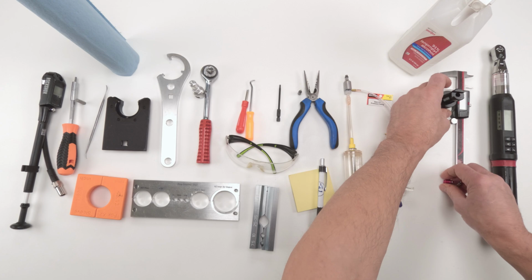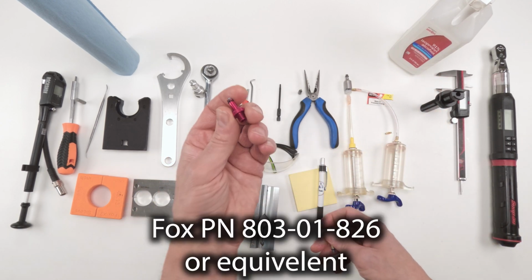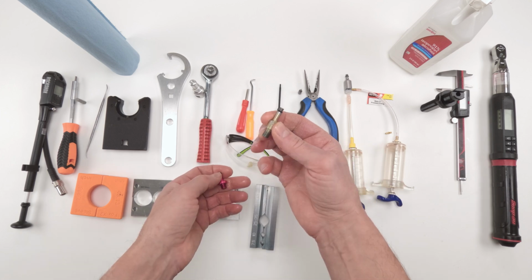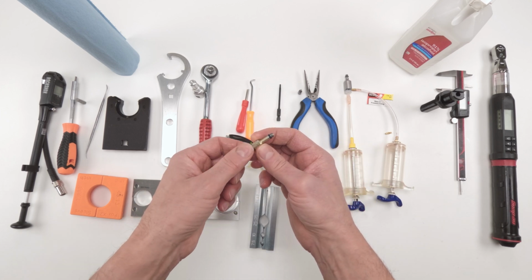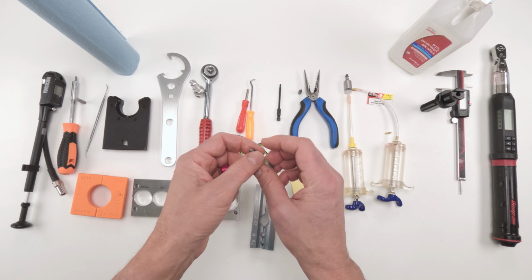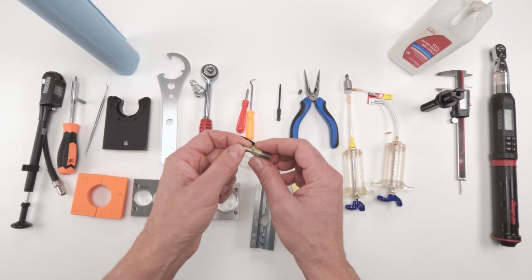Then we need to fill up the IFP with air. To do that, this is your typical air adapter to fill an IFP chamber with a hand pump. This, a subscriber recommended to me. It's a lossless version of this, something that I've been wanting for a while. I've sort of made my own for nitrogen systems.